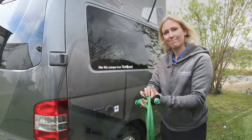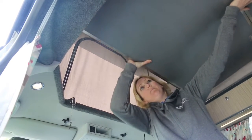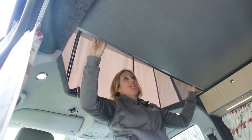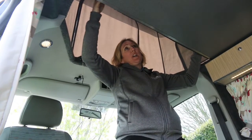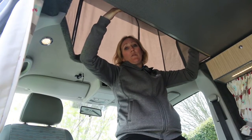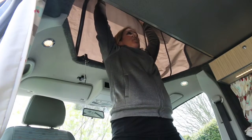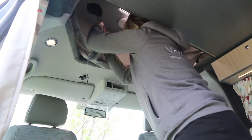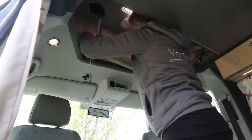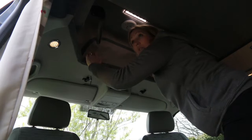To pull the roof down, grab the handle and pull the bunk base down, making sure the mattress is level and not sticking out, pushing the canvas in at the sides. Also make sure the bungee rope is attached at the back to keep the scissor hinges away from the canvas. Facing forwards, grab your handles and slowly pull the roof down - make sure the side door is open again so you don't get an airlock. Bring the roof approximately three-quarters of the way down, then it will support itself. Use your hand to help, and sort the canvas material away.